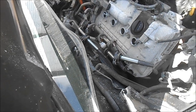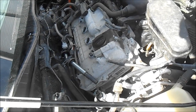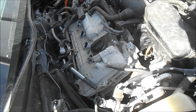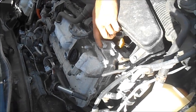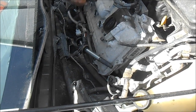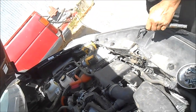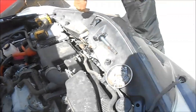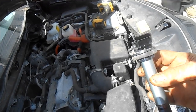And you've got all the spark plugs right down in there. Now it's a great time to change the valve cover gasket if it needs it. I believe on these they just glued it down — there's a gasket in there but they glued it on one side. You can see a little bit of the goo sticking out right there. So this is the coil that's gotta go. Can you test that out of the system? As far as I know, all the tests I've ever done on those are inconclusive. Once in a while you'll test one and it'll be like an open circuit.